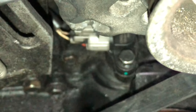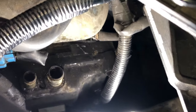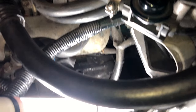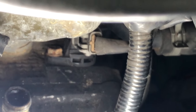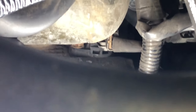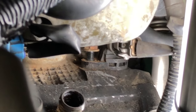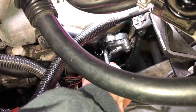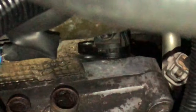Now, if the crankshaft sensor right below the alternator doesn't fix your issue, there is an additional sensor — your camshaft sensor. You can see the top of it right there. I already had my air pump removed and pulled off a couple of vent hoses; the intercooler isn't mandatory. To get to it, I'm using a 10-millimeter opening wrench — you can easily slide it in and get access to the bolt. I already have it unplugged and half of it is sticking out.